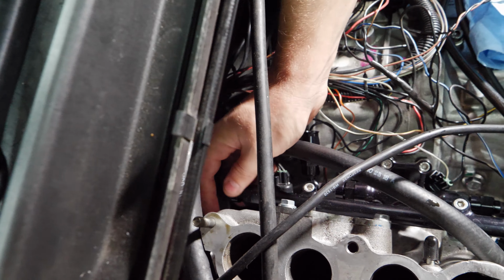The fuel line is gonna run underneath the electrical wire, so those will sit on top of it, priority-wise. And this will sit down here. This other one will go over to here, where I'm holding the whole thing. And then behind that is the fitting for the 8AN, and that'll go down under the car. So somewhere in here, this line isn't as long as I was expecting.